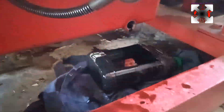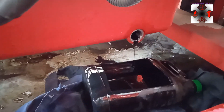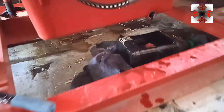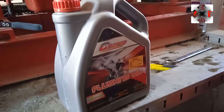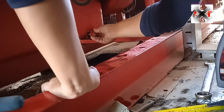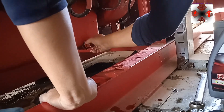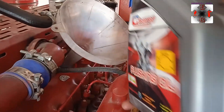The oil has now been left to drain to the minimum — you can see almost nothing is coming out. After you finish draining, you need to get a flushing oil. We're going to pour this flushing oil into the system and run it a little to circulate and bring out all the debris and small particles left inside. Make sure you close the drain first — if not, when you pour it, it will just come out and everything you've done will be wasted.